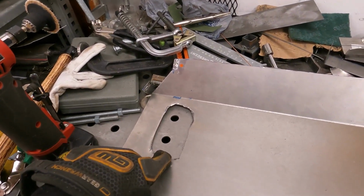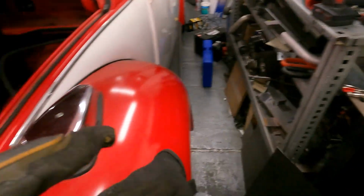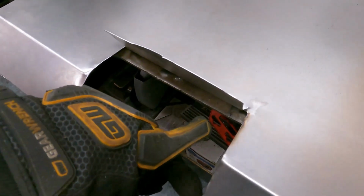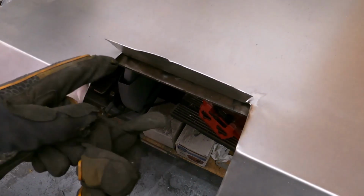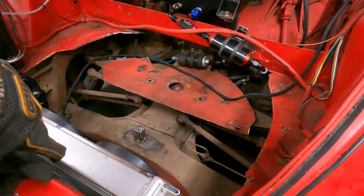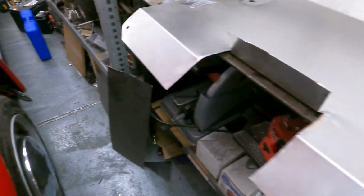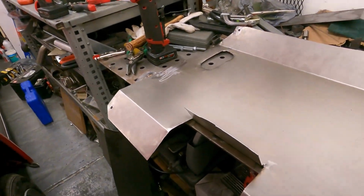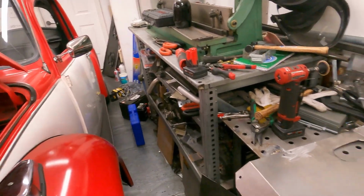So I'm going to create a little hump to go here for our coolant inlet that just gets a little bit in the way. And then I'm also going to put little straight pieces here and here to kind of box this in. This will create a barrier from the hot air on the radiator to the battery. So we'll just box it in, and then all this will get the same Thermotec that we used on our engine cover in the back.